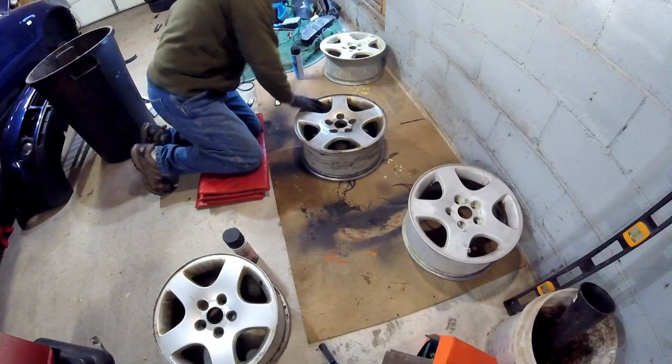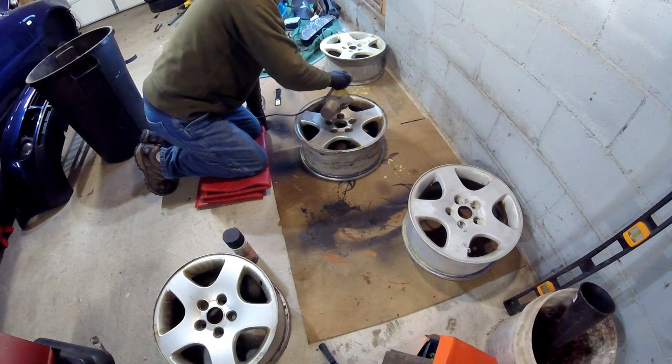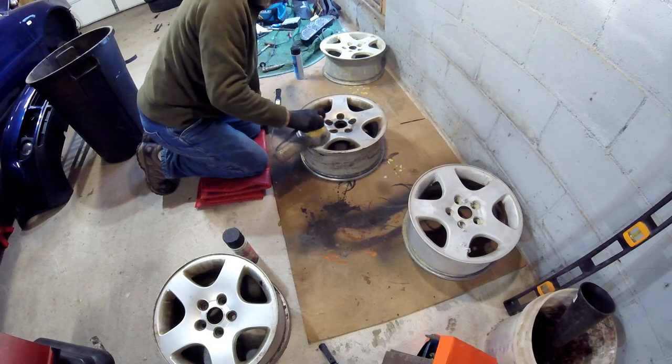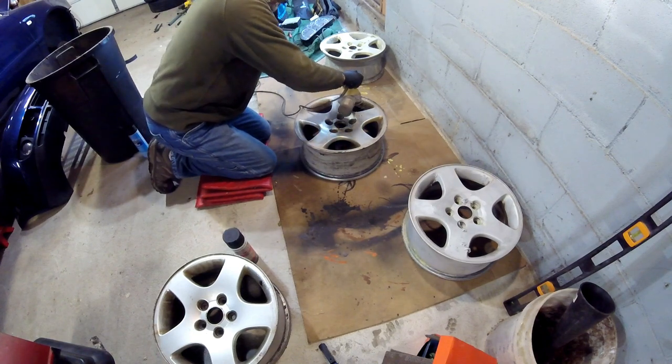You can see just how dirty and gross looking those rims are. Now we're going to skip ahead — very cold day here, so I borrowed a heater. You can see there's my Subaru in the garage. When you're going to use a paint stripper, the best thing to do is try and break that paint loose and give it something for the stripper to bite into. So I took a sander to it and started knocking down the surface. Anything I could hit with the sander I figured may as well try and get the paint off — that saves a little time.